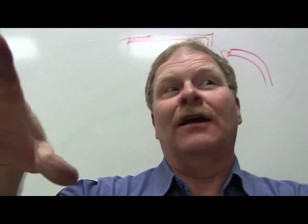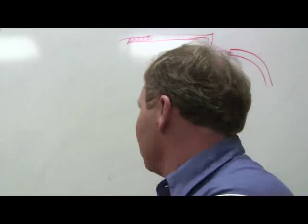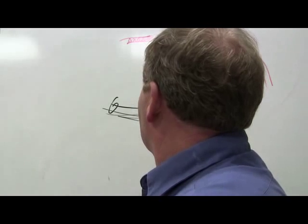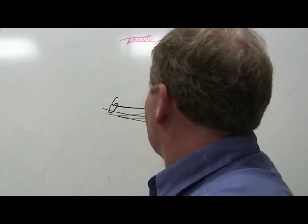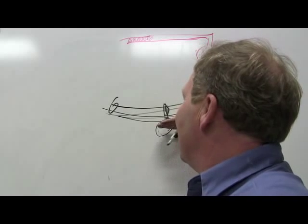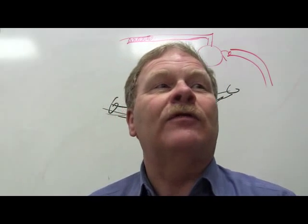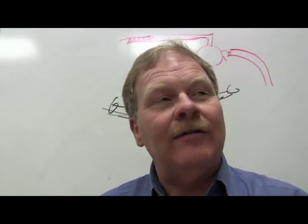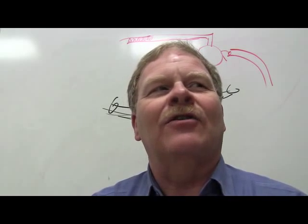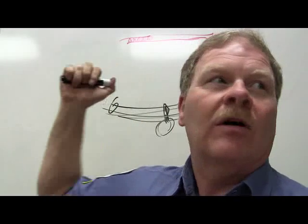It was a thrust line problem. Hitting the obstacle sheared the tie bolt in the leaf spring pack — the bolt that holds all the stacked leaves together and keeps the axle located. The axle literally moved about three inches under the truck. The fix was to jack the truck up, take weight off the springs, and install a new tie bolt. The instructor admitted he had previously used a regular bolt instead of the proper hardened tie bolt, which didn't have enough shear resistance.